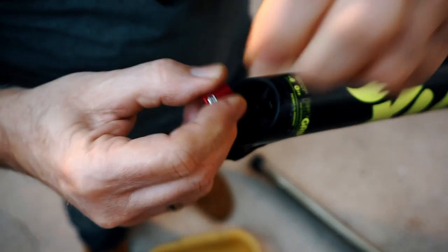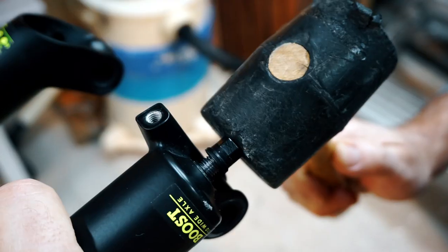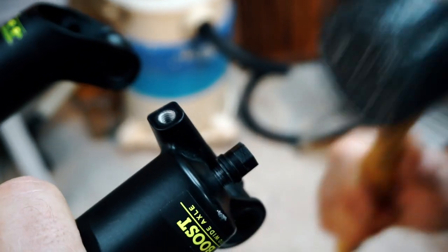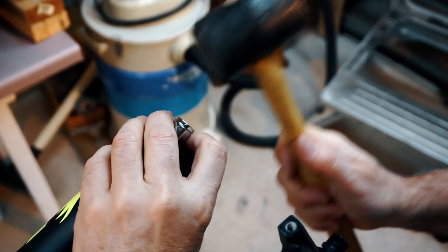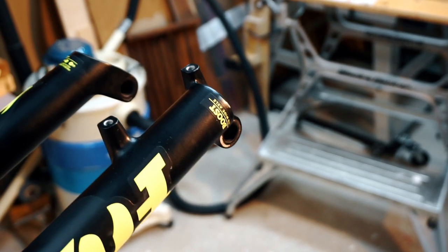Step 1. Remove the lower legs. Step 2. Remove your damper knob, then remove the damper and spring nuts and crush washers. If you don't have a lower leg removal tool, leave the nuts on loosely and use a rubber mallet to release the fork lowers from the uppers. Make sure to use a socket on the damper side to protect the damper adjust shaft.